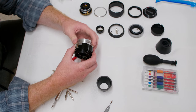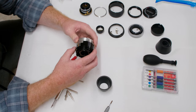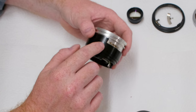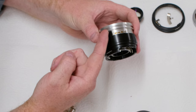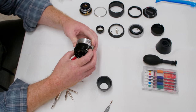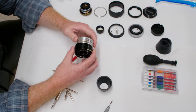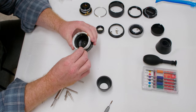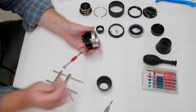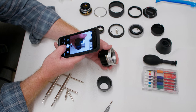I generally notice how far this black part is sitting from this little metal rim. This is where I start getting really attentive to details, because when these pieces screw out and you're putting them back together, the floating element and the helicoid not being reassembled correctly will cause problems — I promise. Take pictures of pretty much everything from here on out. I take a picture of where we're sitting at infinity.